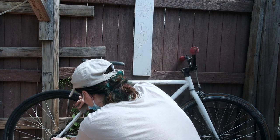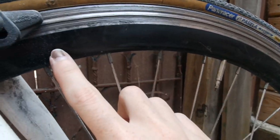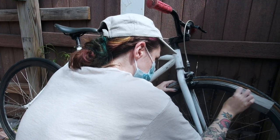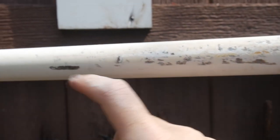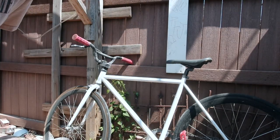I'm going to sand the bike while the wheels are still on and then do the last bit with wheels off. Where the paint has worn off my front rim — you can see where it's all scratched — I'm just going to sand everything to make it all smooth and then repaint it black so it looks like the back rim. This might seem really tedious, but you can see now it's much more clear which parts of my bike are rusting. All of this exposed metal is a risk for rust — I didn't realize my bike was this banged up. Water is definitely getting into the bike; a fresh paint job every seven years doesn't seem too bad. I'm covered in sweat, but now I'm going to rinse off my bike and get all this dust off of it. It is a hot day so I'm not worried about getting my bike wet — it's going to dry pretty quickly.